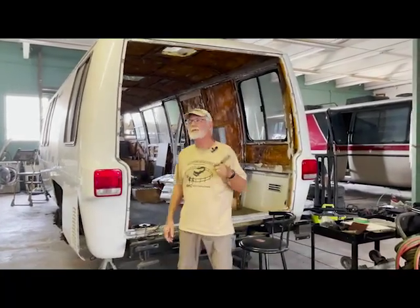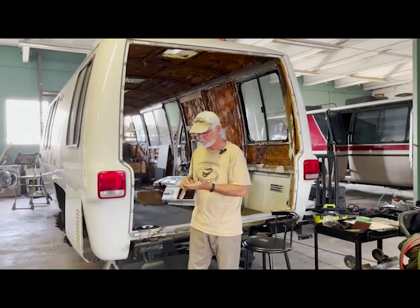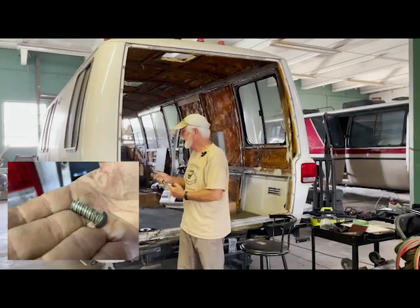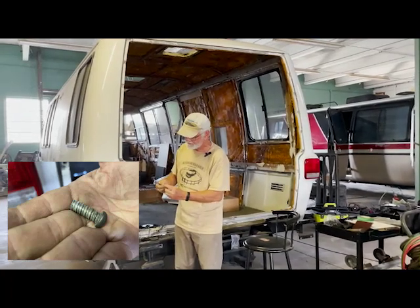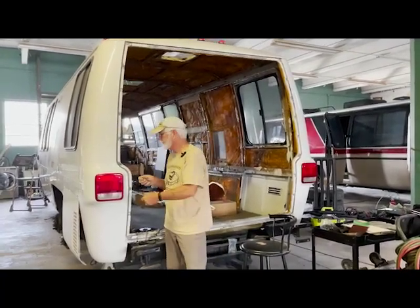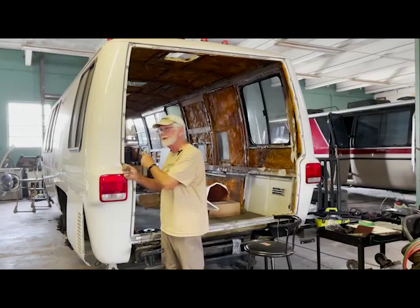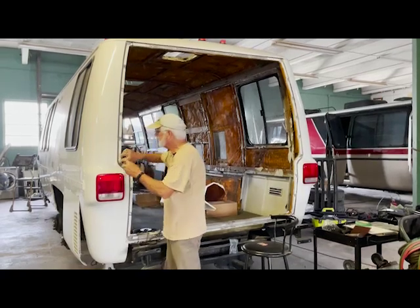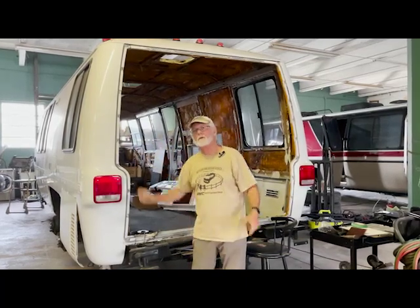So after they had a couple of hatches that wouldn't come off and some big guys got egg on their face, they came up with a new idea. And we'll do a picture of this right here. This was called a high-low screw. Okay? High-low screw has got two sets of threads. It's got a small set of threads, and then it's got a wider set of threads to bite in more, okay? High-low screw was designed to bite into the plastic, okay? So these, you could shock them, break them loose, because you got steel into plastic, or fiberglass if you want to call it, but it's not fiberglass. Steel into plastic. You could shock it, and you could take the screw out. So guys with 75 and after, the rear hatch will come off.